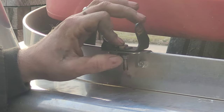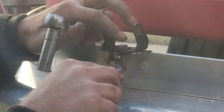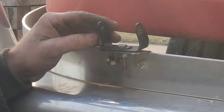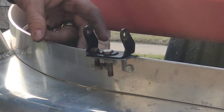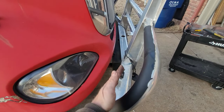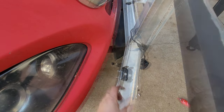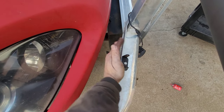Had to cut a little bit off that bolt because it was too long. Just a dab of thread locker. I have to use the wrench — can't get a socket down in there. Wait, I forgot I've got to turn this thing to make it straight. That could be a problem. I should have put some spacers on the back side. This thing sits at an angle, so when the light shines forward it'll be directed off to the side. We need it parallel with the bumper. We're going to have to pull the bracket off and put some washers between the bracket and the bumper to turn it that way.